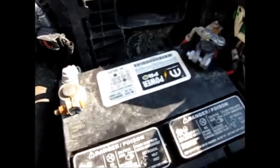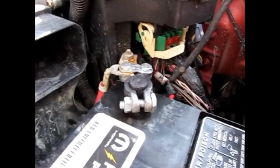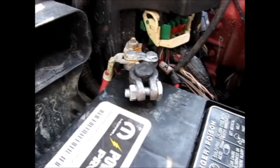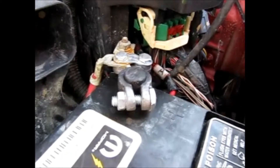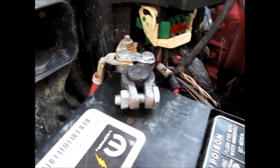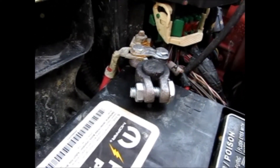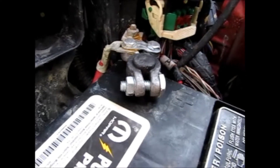This is the battery in the Jeep. As you can see, there's one lead terminal and one tin terminal on here. The tin terminal is original, and that's got a little bit of corrosion underneath it. The lead terminal is the one I replaced, and I used dielectric grease on that when I worked on it — especially around the lead and the posts. You can see kind of a wet spot where I put it on there. But as you can see, there is no corrosion on that, and like I said, that's been a couple of months. This thing was corroding bad before — that's the positive side. I think there's probably a bit of a hydrogen leak right there around that terminal. If I were to do anything more, I'd really slather that stuff on there to help protect it, but since it's doing good right now, I'm not going to mess with it.